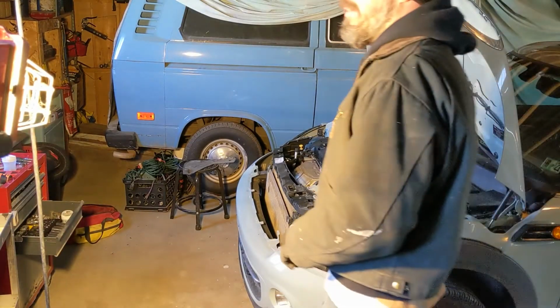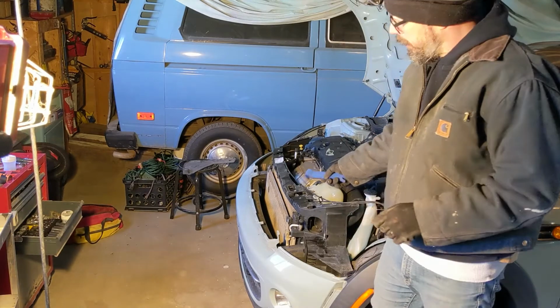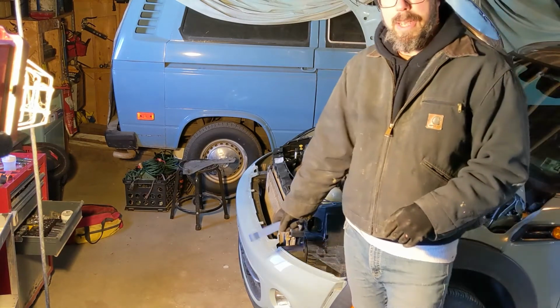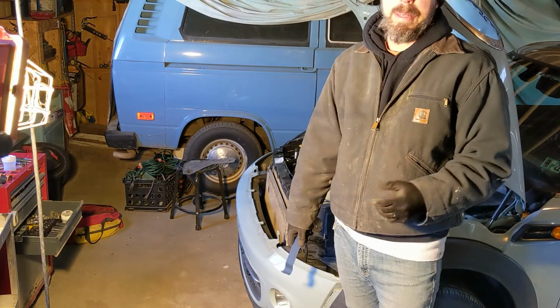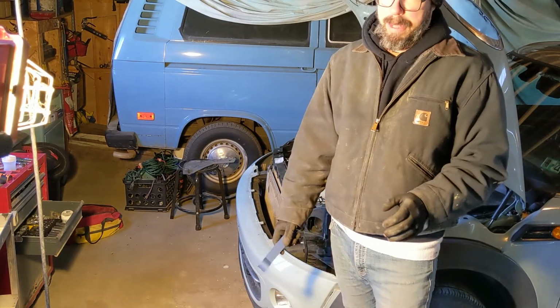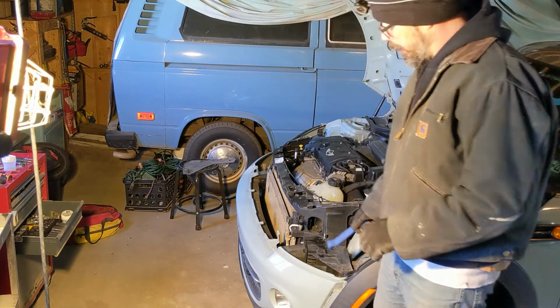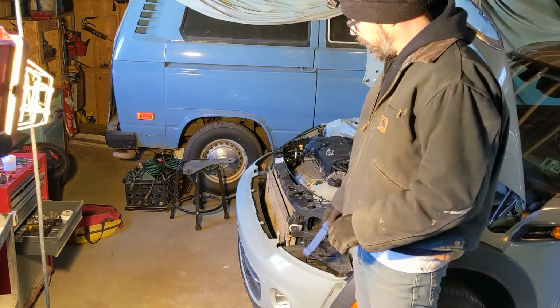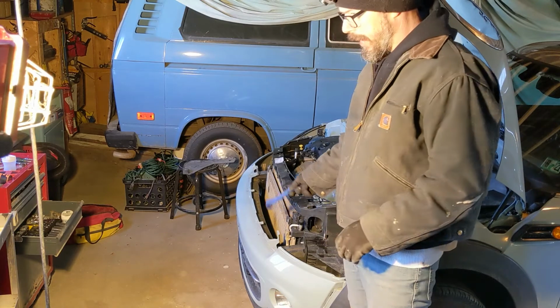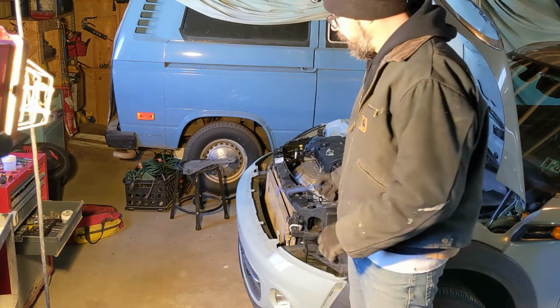All right, more plastic clip goodness. A couple of them were scuffed off or kind of ground off on the bottom from hitting curbs, so that made them impossible to get off. So a couple more broken plastic clips. I did get a couple off successfully, and now I think that this is loose to the point where I just have to unplug the fog lights and the external temperature sensor. So let's do that, and we'll take the bumper right off.